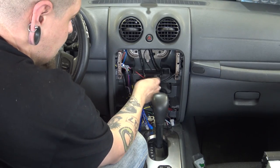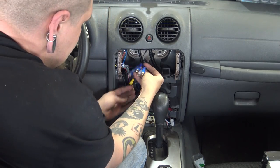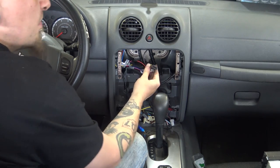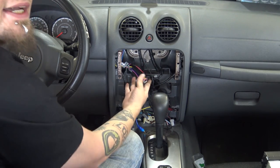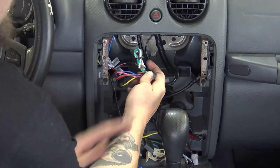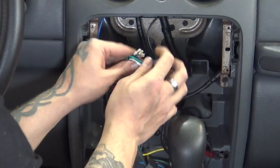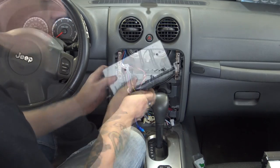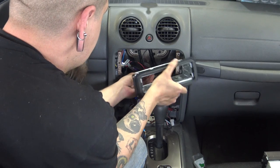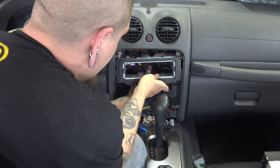We've got everything ran and taken care of. We've got our backup camera, the RCAs for the amplifier, the harness is wired up. It's a pretty standard harness just like any other head unit that you would have. The only difference being these are the speaker wires and we're not actually using any of those — I put some heat shrink on the end of them and folded them over so they couldn't connect with anything. We have the cage locked in place and we're going to go ahead and feed all the wires through here first.